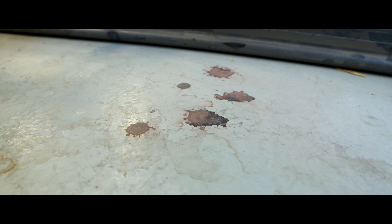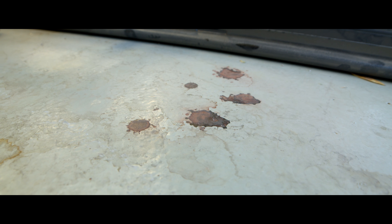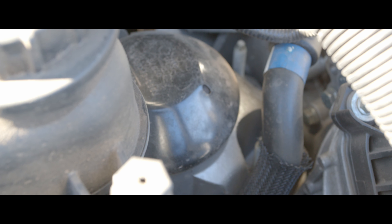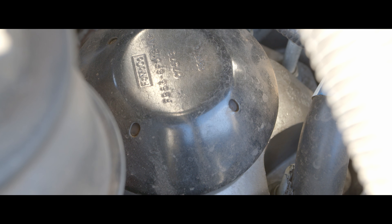One day I found a reddish liquid leaking in my garage and thought it was transmission fluid, until I noticed it dried up in a day or two, which was kind of weird because transmission fluid wouldn't evaporate. The liquid was actually from the hydraulic motor mount on the passenger side of the motor. I do have a hundred-thousand-mile warranty and need to bring it in for the PTU service, some recalls, as well as the motor mount.